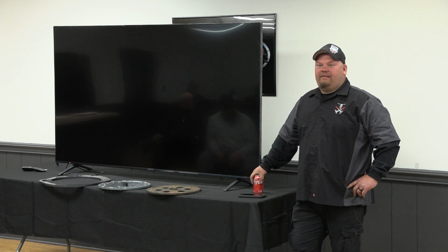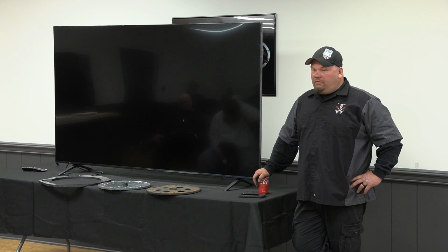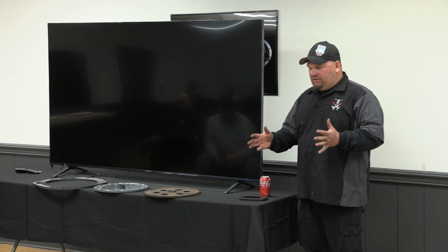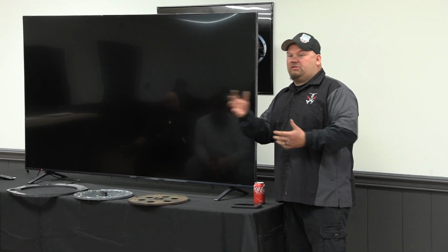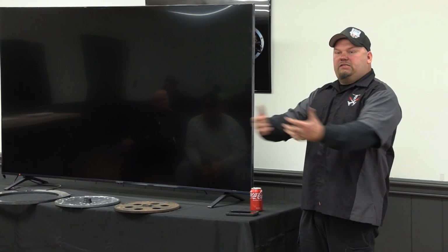But do you prefer a big cam or a small cam? No cams. Honestly, I've talked to pretty much everybody about engine work. I've talked about cams. I sell cams all the time. I have them all on the shelf. Tuning, carbureted, EFI, it doesn't matter. What happens is there's more that goes with it. It's the springs, it's the converter, it's the extra heat, it's a bigger transmission cooler. It's the whole package. So I try to make the customer aware of the package that's involved with it.